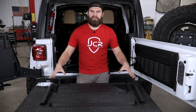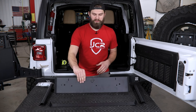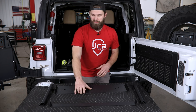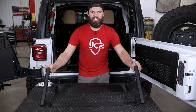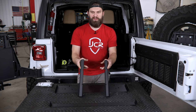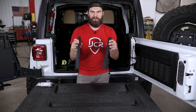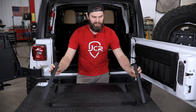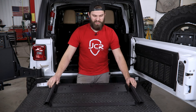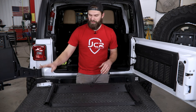The parts you'll need to start out with to assemble the frame are what you see here. You have the top logo plate, the lower cross brace and mount panel, as well as the two side uprights. These are mirrored parts, so you will have a left and a right. The closed end goes toward the top, leaving the open end for the bottom, so you can decipher left and right using that information. We'll bolt this all together using the quarter-20 button head hardware in your bolt pack.